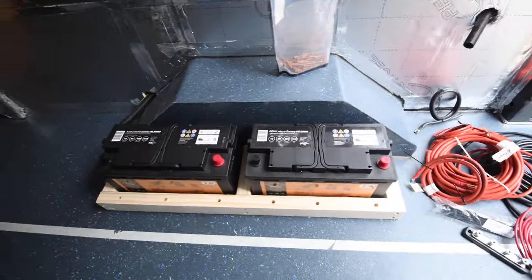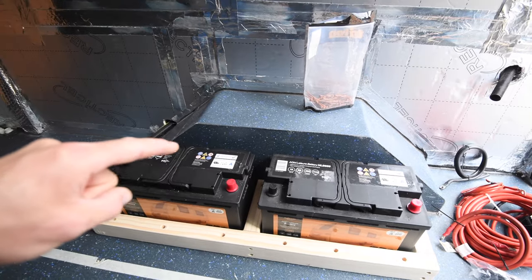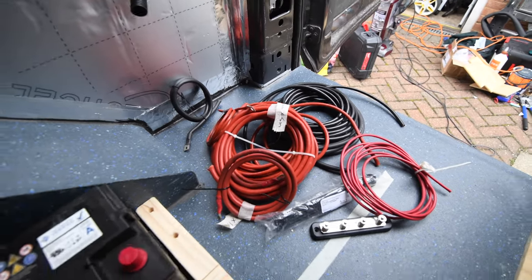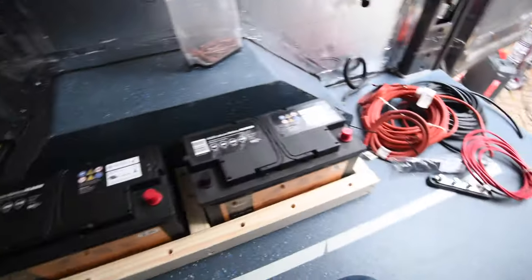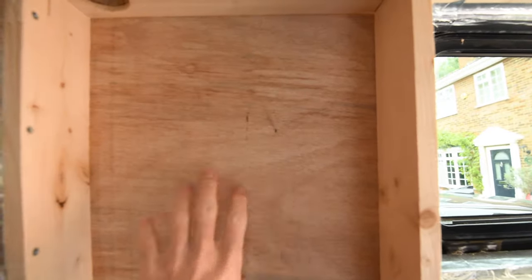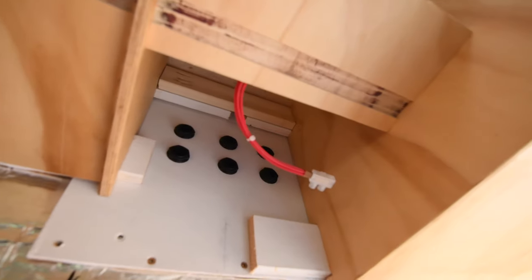What I'm going to achieve today is to wire these two batteries together in parallel — keeping the voltage at 12 volts but increasing the amp-hours — and then connect my range of wires. I've got 25mm² wire, 16mm wire, and a variety of fuses and lugs. The plan is: positives go to a bus bar where the battery charger and DC charger join, and the negative bus bar is at the back where all my conduit leads, so the wires will be nicely hidden.